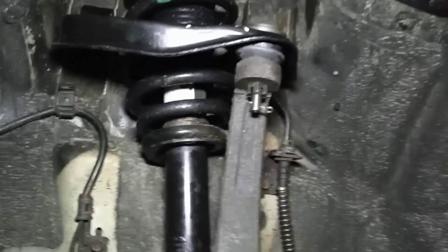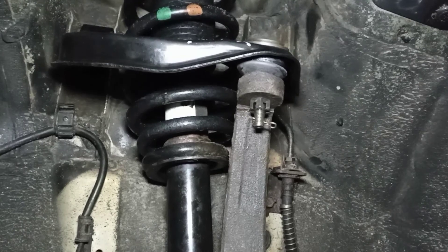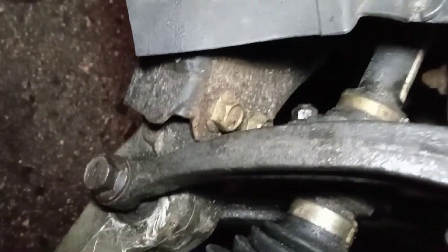After a really long day — as you can see it's pretty dark out — I had the worst time putting this in. I had to go to the junkyard to get the control arm, but it was the wrong one — it was for an 06 and my car's an 07. Then I had to drive all the way up to Nashua to get the right part. I put the old strut in since I have an 06 strut and didn't want to risk it. I tightened everything down — the 17s, 19s, 15s, 12s — all bolted down pretty good. The right angle impact came through a couple times, and the big brother only had to come in for one bolt. Pretty happy with the result — see you guys soon!